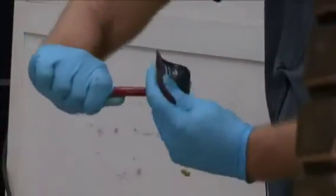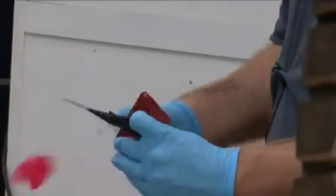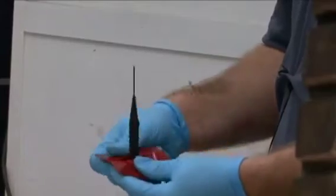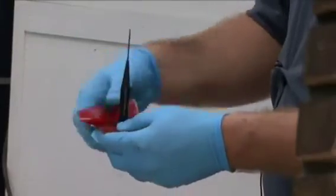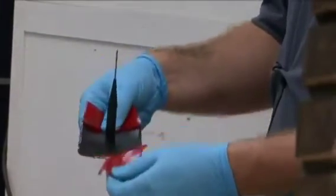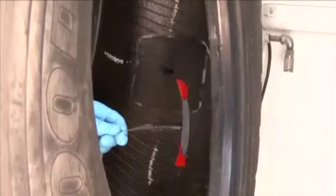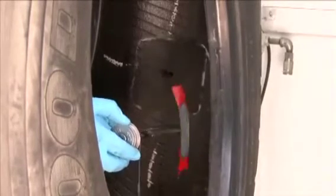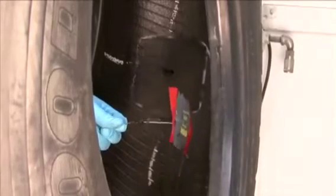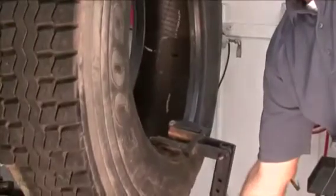While the Super Solution dries, remove the Maxi Seal repair unit from its protective wrapping as shown, without touching the cushion gum. Touching the cushion gum will cause contamination that may lead to repair failure. Apply 608F Super Solution to the black, tapered area of the stem only. This ensures proper lubrication to make the application of the repair unit easier. Make sure the tire beads are relaxed. Remove the spiral cement tool.